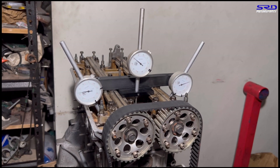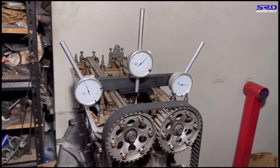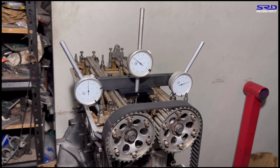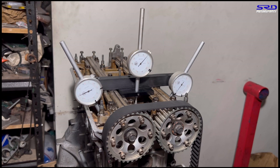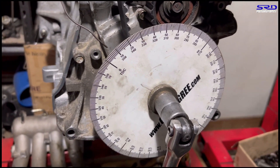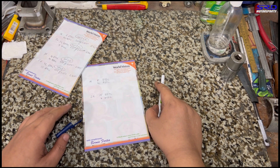For the exhaust closing, we go to max lift and continue to the closing point at 0.050. I overshot it — importantly, do not reverse the rotation clockwise, as belt stretch will change the readings. Instead, continue counter-clockwise for another full turn and approach 0.050 again. The exhaust closing reads 7 degrees after top dead center.